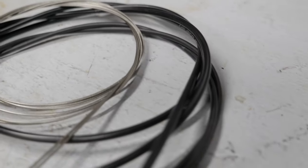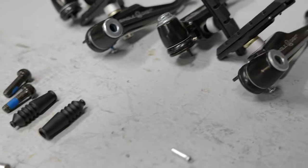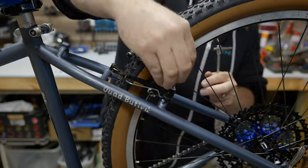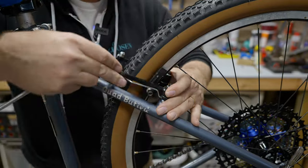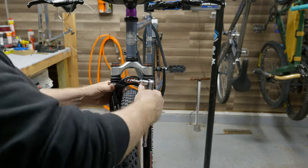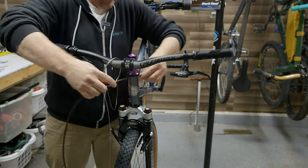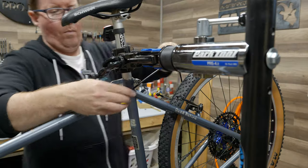If you've been watching my channel for a while now, you know I'm really big on using new cables and housing as much as possible. There's something about using a brand new stainless steel cable with some nice ferrules and good SIS housing that just makes everything work better. Down in my Amazon affiliate links, if you want to help support the channel, I list some good inexpensive brands that are out there. Whatever you use, something else I would suggest is making sure that you take your time to measure and cut things so that the loops have just enough slack to help you turn left and right without there being a huge loop hanging out front. Sometimes I'll get funny comments about this because people like to have their housing really short. I'd rather have something that doesn't have any issues turning right and left.